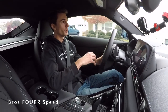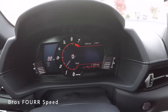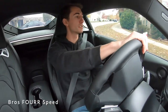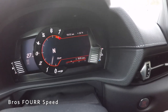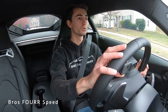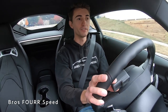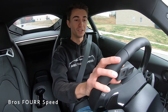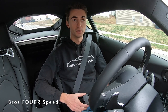Number four: a lot of people think coasting in neutral downhill saves gas. Coasting around 20 mph in drive, my MPG gauge shot up over 90 — basically 100 miles per gallon. Doing the same test in neutral, the gauge stays at 100 MPG. So you get no better fuel economy coasting in neutral versus drive. More importantly, it's a safety issue — in neutral you have no engine braking and no acceleration, only your brakes. The car's computer is smart enough to cut fuel when you're not using the throttle anyway, so leave it in drive.